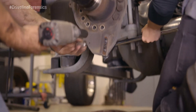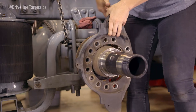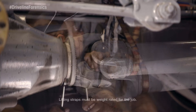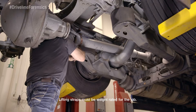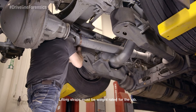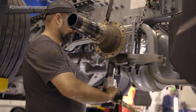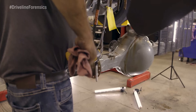Once that's done, I can unbolt and remove the torque plates from the axle flange. Then unbolt and drop the prop shaft from the drive head. Now before we do anything else, let's secure this axle with some lifting straps. Now we'll remove the shock hardware, unbolt the upper torque rod, remove the U-bolts, and lower the axle housing to the floor and remove it from under the vehicle.